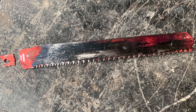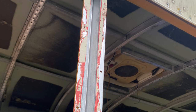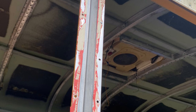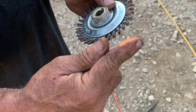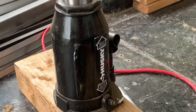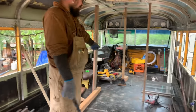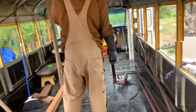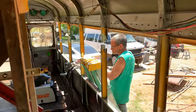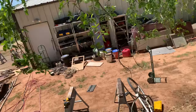This one broke within the first three seconds, so I ended up using a bunch of really cheap torch blades and they worked great. We also needed to clean all of the industrial glue off the outside of the hat channel, and the best tool for that turned out to be a wire brush attached to a grinder — I tried a heat gun but it was ineffective. We used a 20-ton bottle jack — about 50 bucks — and it's a great investment. We used it on John's roof raise and it just pushed right up. One final step: we added some improvised scaffolding on the inside in case of catastrophic failure, which we weren't expecting, but it's always good to be safe. Now it's time to raise.